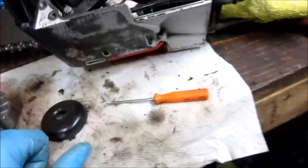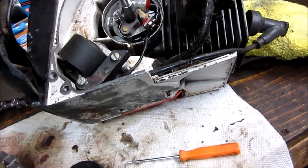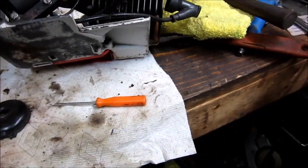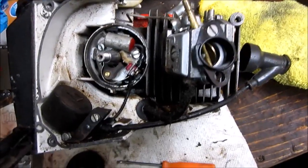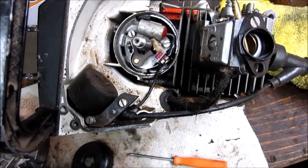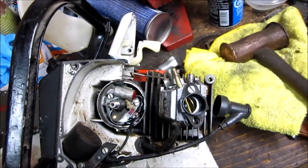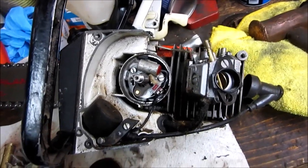Now I know it's points. It's just like somebody hitting the on and off switch repeatedly — that's what points sometimes do when they get oily and dirty. So I'll pull these out, clean them, and reset them. I haven't made any videos in a long time — been busy with a lot of stuff. We'll clean and set the points, put her back together, and fire it up. Just a quick little video. Still here — hope everybody's doing good. Don't forget to comment, like, subscribe.